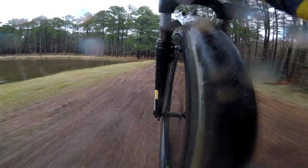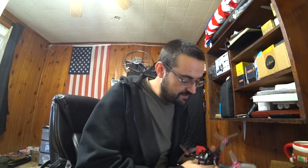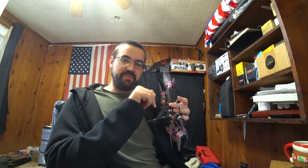I know this from working with drones. And yes, there are some similarities here, because there was the same paranoia with these motors for a lot of people, until we just became more familiar with them. Now, inside this motor is no moving parts other than the bearing and the shaft that goes through it. There's coil wires wrapped around stators. They're energized and it moves a magnet. It's the reverse of what's going on inside the motor, with a few variations. But these can get wet. You can completely submerge these brushless motors in water and they'll work just fine.